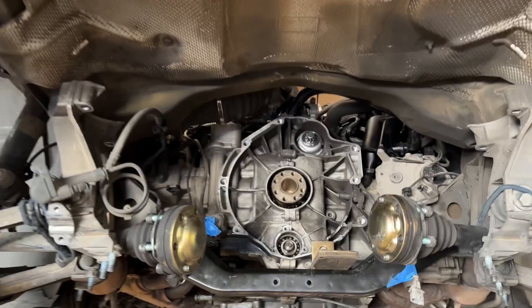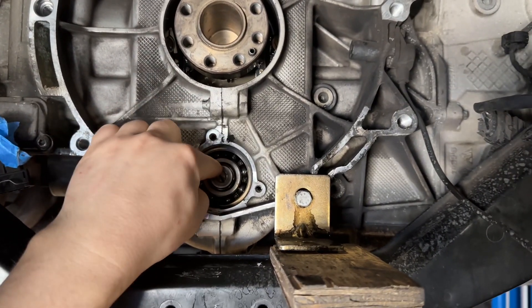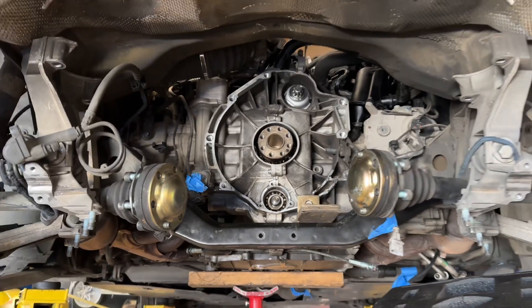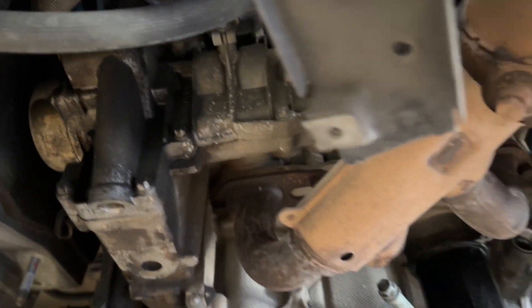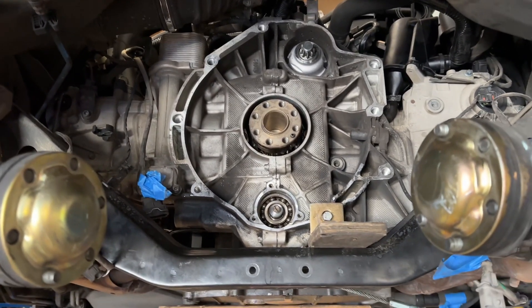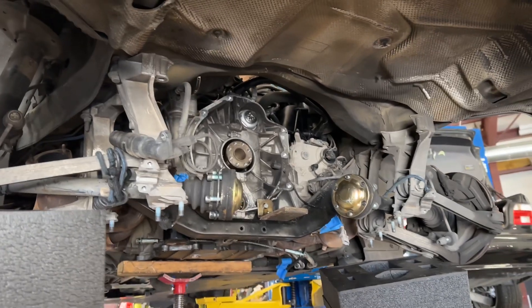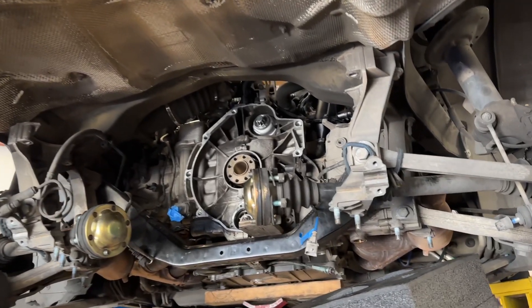There's a lot more to mention. The ceramic bearing that Porsche incorporated in all 2006 and up vehicles — also the lawsuit cars had this same bearing incorporated in the early 996 and 986 vehicles. Some vehicles with the M96.2 variant engine with the VarioCam system, even 2003s, can have a single-row large non-replaceable bearing if the engine was replaced when the vehicle was part of a class action lawsuit. So keep that in mind.